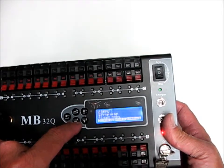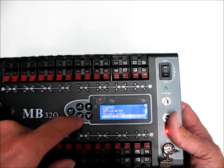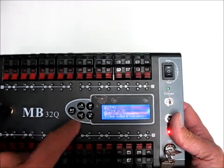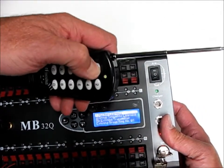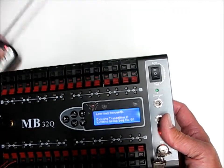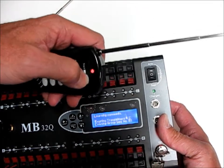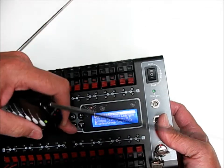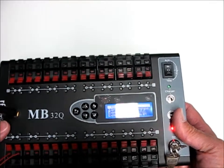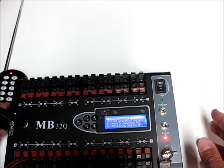The second option is to go into the program menu. Clear all codes again — codes cleared — then go to number 4 which is 'learn codes,' hit enter, and push a button on the remote. We've now put both remotes into it, so this module will now respond to a button push from either of these two remotes.